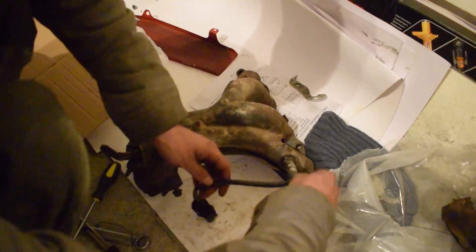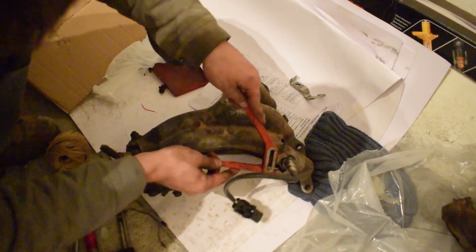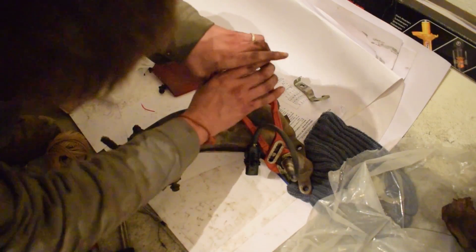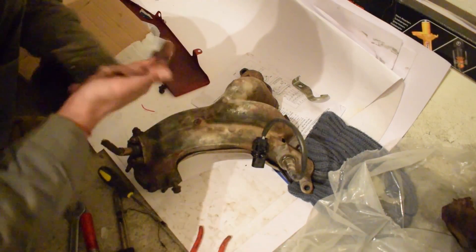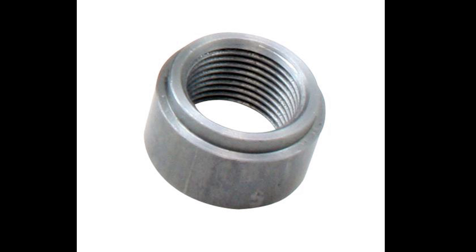Next up, it's time to install the Bosch wideband sensor into your exhaust manifold. As a very temporary solution, you can see me installing the sensor into my EGR hole. I did this because it's easy, the sensor fits perfectly, and I will be replacing this exhaust manifold really soon. To do this properly, you need to install the sensor somewhere where it can sample exhaust gases from all the manifold runners, and it also needs to be installed at an angle greater than 10 degrees. If you don't have a suitable hole in your manifold, use the provided bung that needs to be welded in.